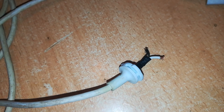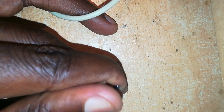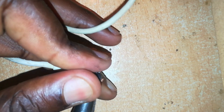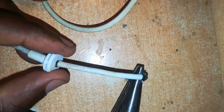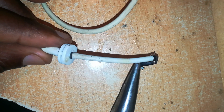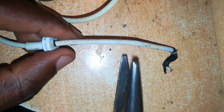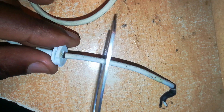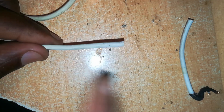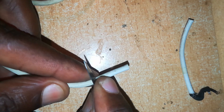We're going to cut off a piece of this end and see if it makes any difference. First, I need to slide the junction back by pulling the cable using this pair of pliers. I'm assuming there is a break in the cable somewhere here, so I want to cut the cable at some point along its length, give it a safe distance, then prepare the end and test it again.